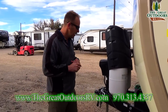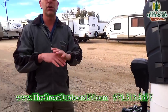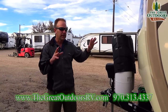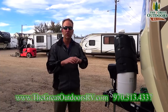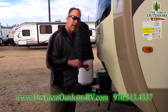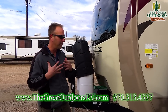One of the special features I like to talk about on this coach is the battery disconnect. It's located right in front of the battery box here. What this battery disconnect does is turn off all power to the coach — because believe it or not, if you park this for the winter or a long period of time without a battery disconnect, there's an LP sensor inside the coach that runs 24/7 and will actually drain your battery over time. There are really only one or two ways to completely turn the battery off: either disconnecting it or having the battery disconnect on board, which in my opinion is a must-have.